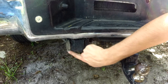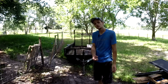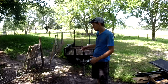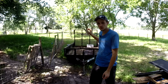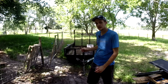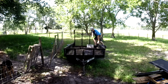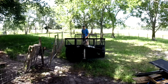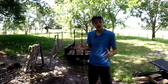If your trailer is pretty small like this one and you have a little muscle, it's not too difficult to just lift it up and walk it to the truck. You can back up close, and instead of fiddling to get everything perfectly straight and aligned while backing up, you can just pick it up and move it into place. If you're struggling, you can put a little weight in the back of the trailer — a friend standing on it, or cinder blocks — to lift up the front so you can set it on. Be careful though, because too much weight put on too quickly on a small trailer can make the back fly up, as you can see. So I'm going to pull the trailer forward, set it onto the ball, and then show you how to secure it.